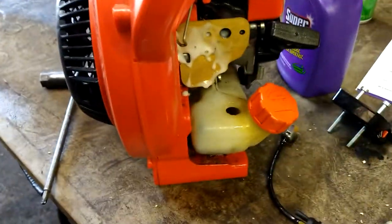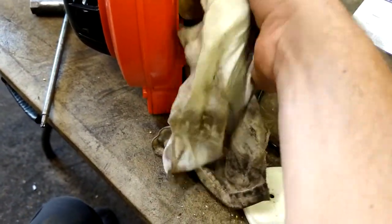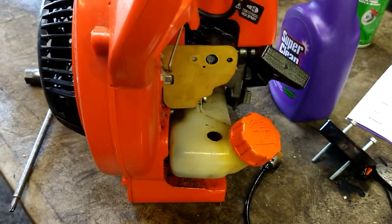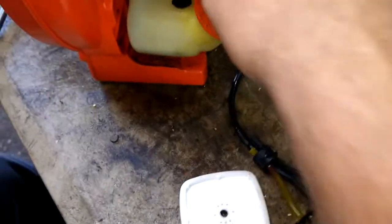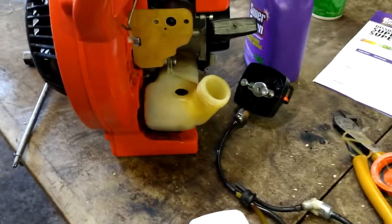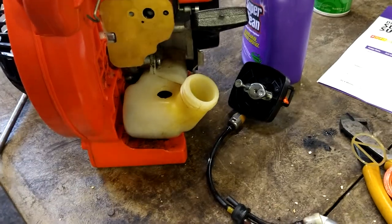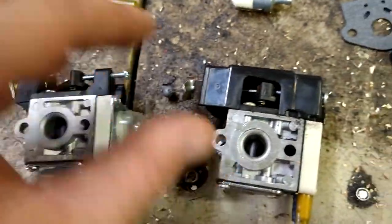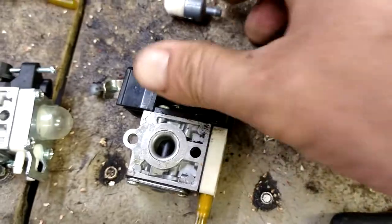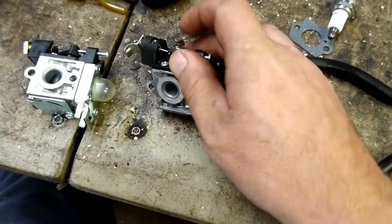The old gasket you can use too if it's fine. Put a little degreaser in there — try not to get it down in the hole, that will keep it from sparking. To get the gas cap off and out of the way, it just pulls right out. Drain it into a container and take it somewhere that will actually dispose of it properly. Now we've got to get the new carb prepped — you can see this is at the wrong angle, it's got to be at the correct angle. First thing, we're just going to go ahead and pop this cap off.